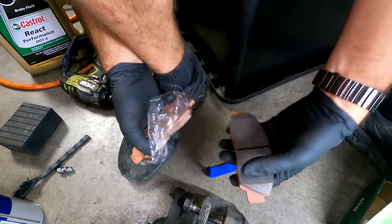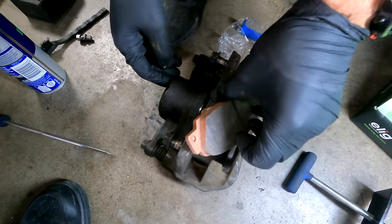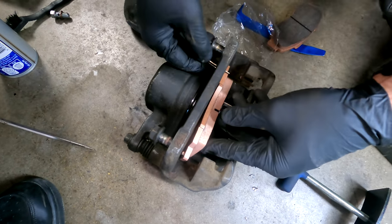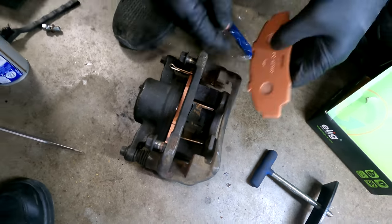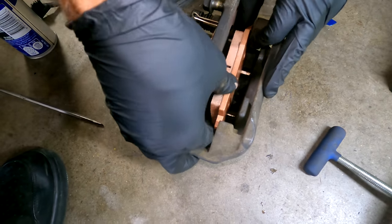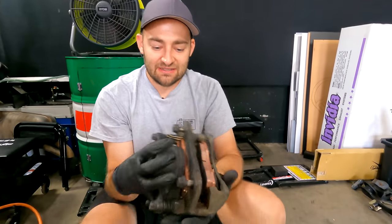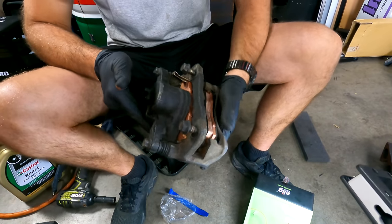So, pads go in that way somehow. These look a little bit like Subaru calipers. I would even suspect that a similar company, if not the same company in Japan, is making Honda and Subaru's bits. They're double dipping, man. They're double dipping those calipers, but that's a nice, neat, easy upgrade. I love that that's a factory mod. CRV calipers on a Civic equals bigger surface area, bigger discs, just a little bit of fiddling. I think that's really clever.